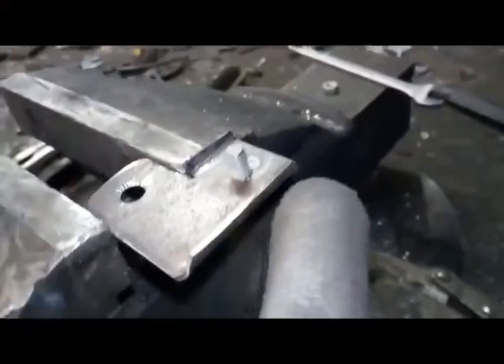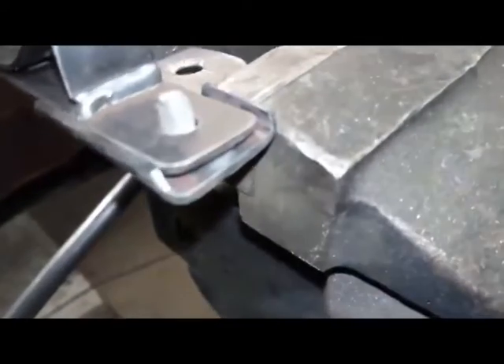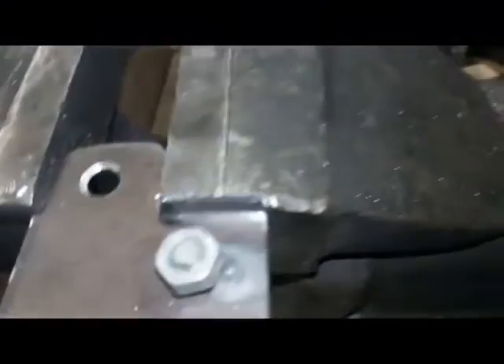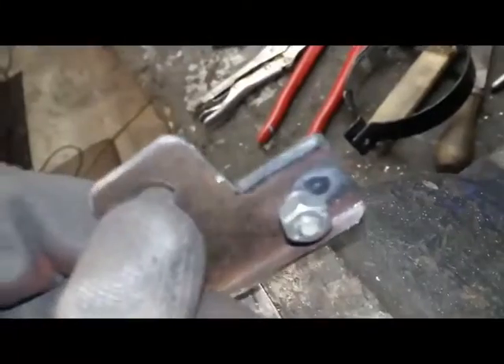Here's the little bracket I've come up with. The hole here is for a plug weld, and when it's sitting inside the car I'll be able to put a little bit of weld along the top and a couple of spots along. The piece I've bent around will stop the bracket from going side to side. What I normally do is put the nut down and give it a good tight one with the spanner, then check the back to make sure the plug weld isn't pulling up — it shouldn't be concave, because if it is, the stud is starting to pull out.